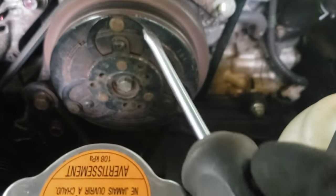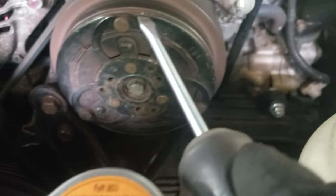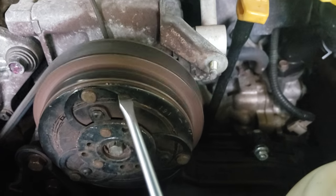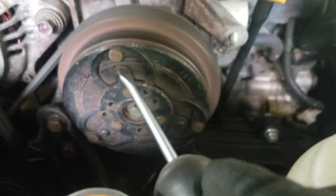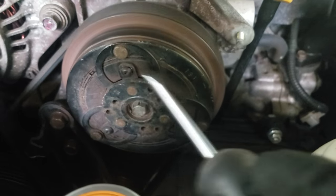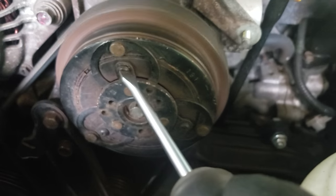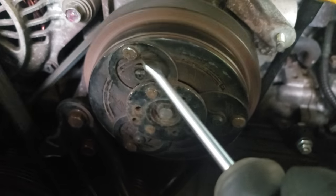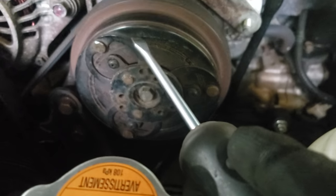Your clutch has springs. See the gap? That gap is too big. So in order to tighten up on that gap without replacing it — this is just a quick fix for now, you will need to replace the clutch — but in the meantime there are rubber grommets right here, and these rubber grommets keep the tension on this spring tight.